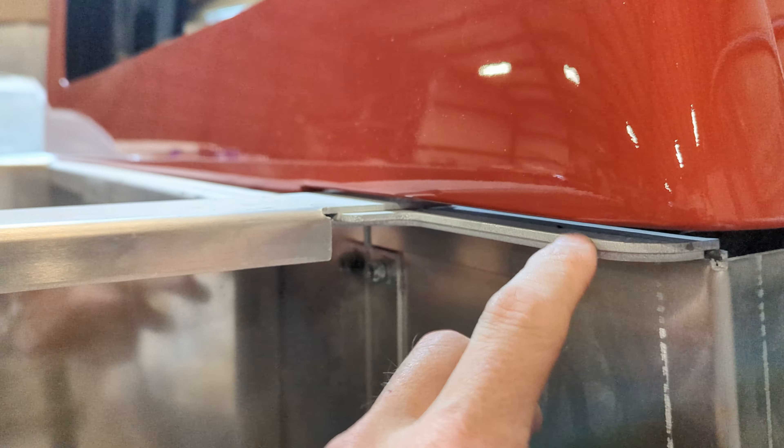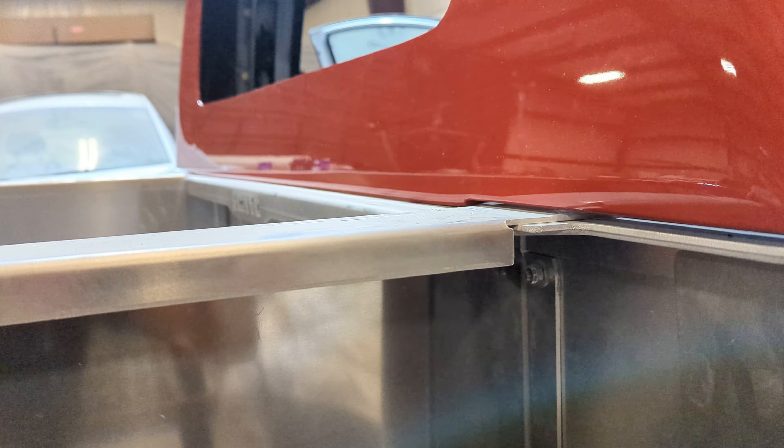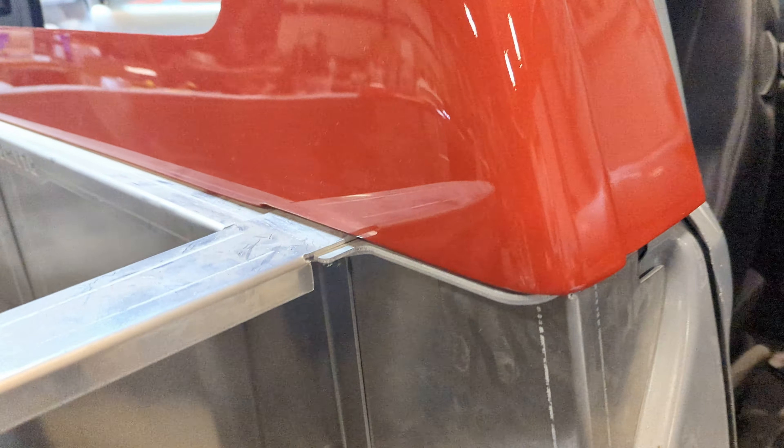You'll see there's a little bit of a gap out here for the body to slide under there, but the inside area is almost flush. I don't use the spacer anymore. There's a little 1/8-inch spacer in the kit that you can use if you have too big of a gap. If you lift the bed and then cinch it down with this side piece right here, you can put a piece of wood under here — whatever you want to do — and that will hold the bed at the right height at the front.